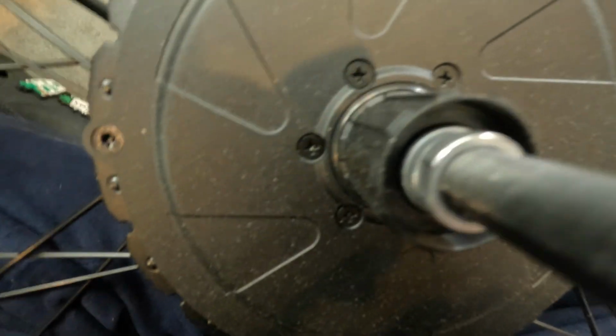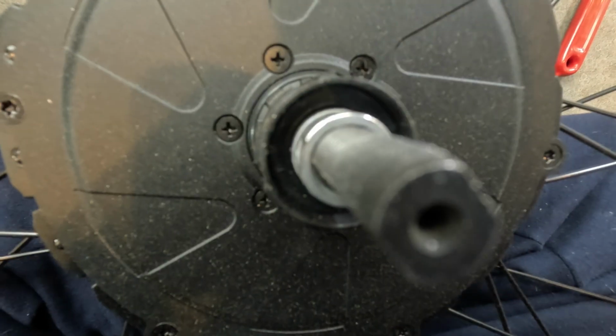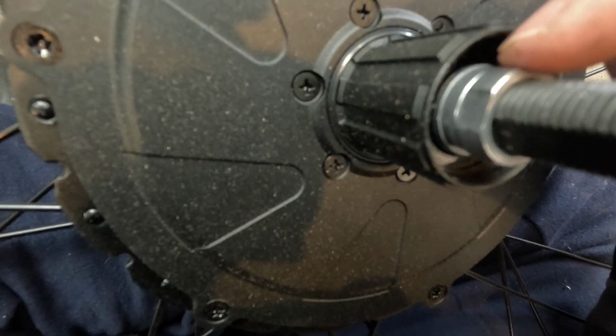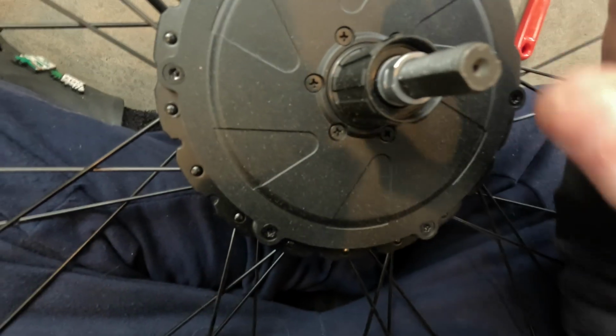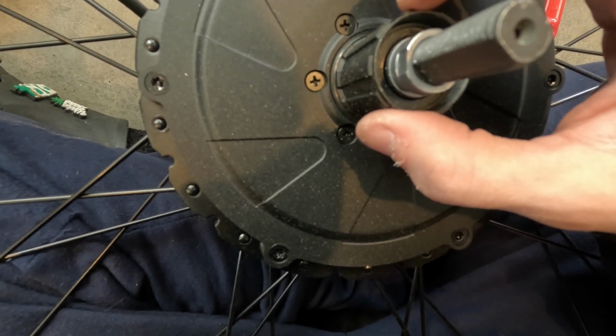All right, so we're back. I don't know if the GoPro was recording there or not, because the whole screen looked black. But I think this is an M14 axle, and then it's got that big jam nut on there. Is this two separate jam nuts? I think they're definitely separate. There's one jam nut right here that's just a single boy. But then this jam nut down here is like one of those ones that was on the G63, the double boy, where it's got flats on it. But then there's another part of it that goes down in there and hooks onto the axle. It threads all the way down the axle, and then there's a flat part machined on the axle that the jam nut presses against back there.